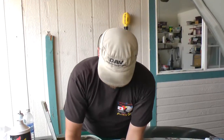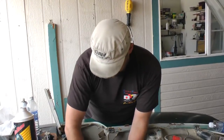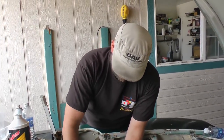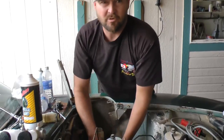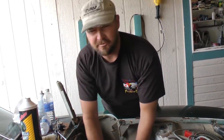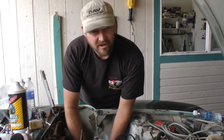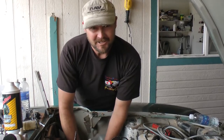We're going to make a separate video for bleeding — we're just doing removing and installing today. In our next video we'll show you how to bleed the brake master cylinder as well as the clutch master cylinder. There are a lot of opinions about bleeding, but the most important part is that you bleed it enough to get all the old nasty stuff out. Basically, you do it as many times as you need until the brake pedal is firm, the fluid is nice and clean, you brake evenly, and your car isn't pulling to one side.